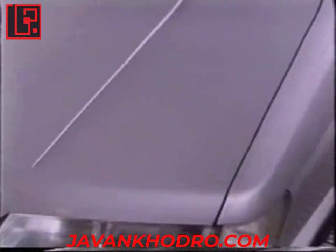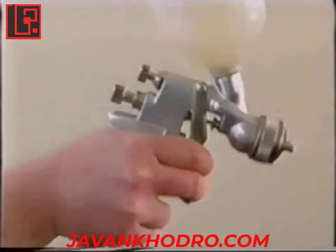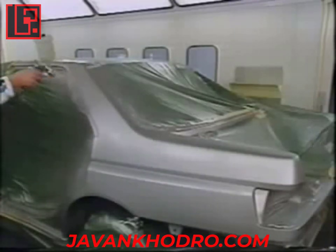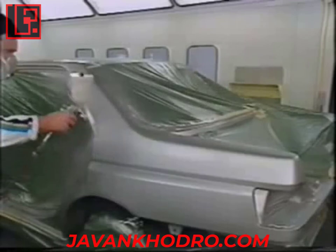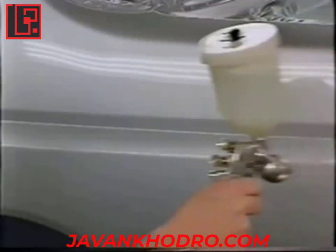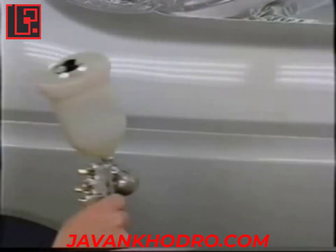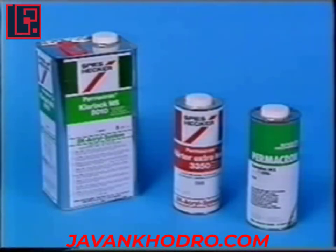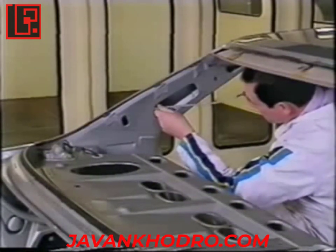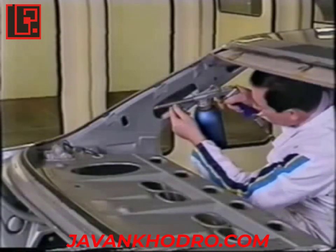Check the covering properties, keeping an eye on the guides. After checking the vehicle brightness, adjust the varnish flow to obtain the same surface condition. Then apply two varnish coats. Comply with the pre-drying time, then go to the drying phase. After cooling and masking removal, inject wax into the hollow body sections so as to protect the areas treated in the sheet metal workshop that are difficult to get at.